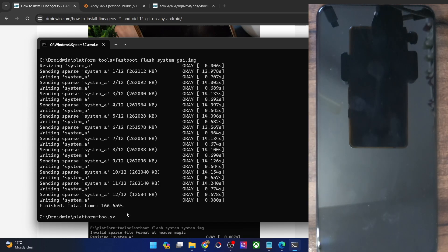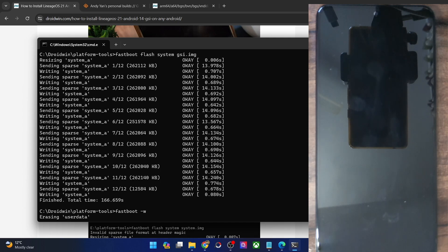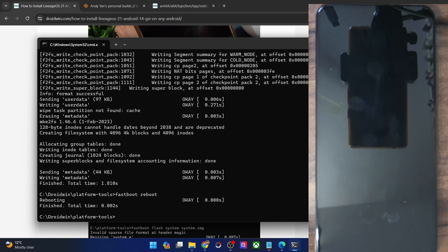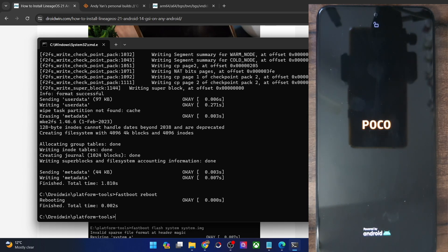The flashing is now complete. Your last course of action is to do a format data, which will wipe off all the data from your phone. Just type in 'fastboot -w' and hit Enter, and it will now start the format data. Once that is done, you can boot your phone to the OS — type in 'fastboot reboot' and hit Enter. Your phone will now reboot into the OS. Do keep in mind that the first boot up might take some additional time — this is completely normal. Let's wait for the boot animation to show up, which will signify that flashing has been done successfully.